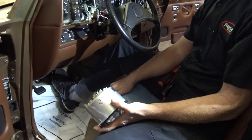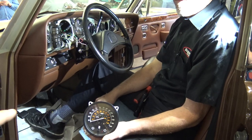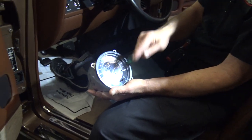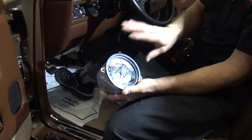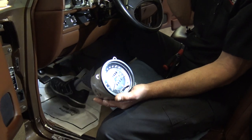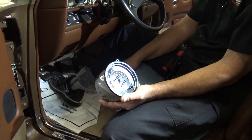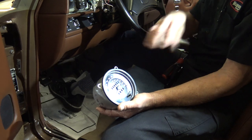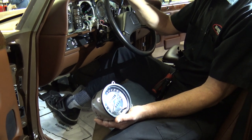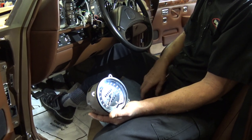Any questions? Who's the main manufacturer? This is a Jaeger. And on here, the only thing you'd want to fix is the gear? What happens is the miles have to accumulate, and typically what happens when the plastic gear breaks is the speedometer still reads — you can tell your speed — but the miles never change. And that's what usually is the problem.